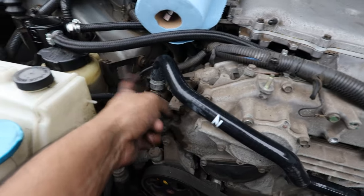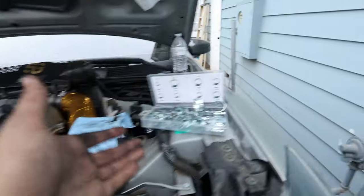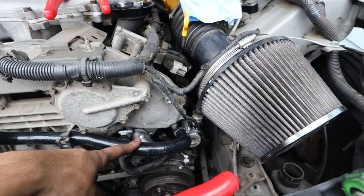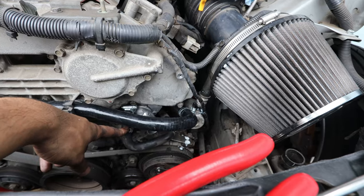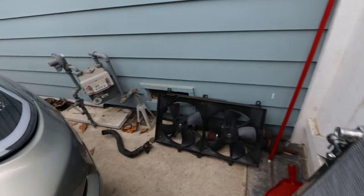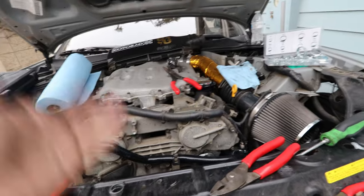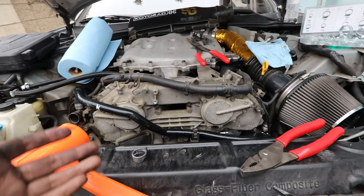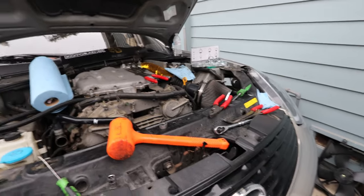It's been a minute. One of the harder things was putting the spring clamps back on, so I went with regular clamps instead. I also installed the thermostat and put a clamp there since the spring clamp broke while removing it. The only thing left is to put the radiator on and then the fans. I'll put the hoses on at the end to make it a little easier. I also have a tool I'll show you that helps bleed this car super easily — you don't even have to worry about bleeding it.